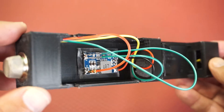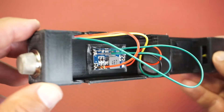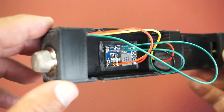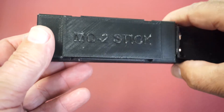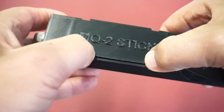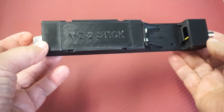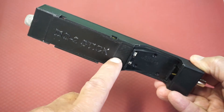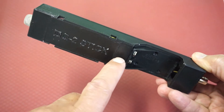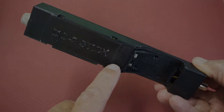Final word: those Dupont cables — the wire — will simply refuse to tin. So that's why the crimp ends were kept. Maybe the wires are a bit long, but at least the crimps are able to solder onto the boards. All that is left is to snap on the lid. As usual, I share all the build information and the STL file in the video description. Subscribe if you're into this kind of stuff, and hit that like button to help the channel out. Talk to you guys soon.